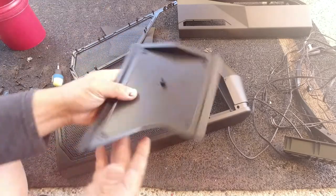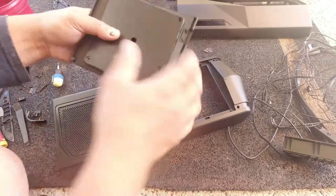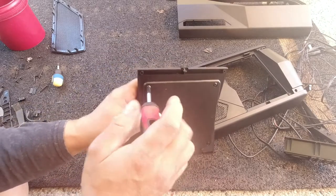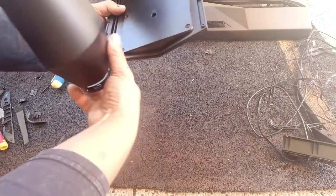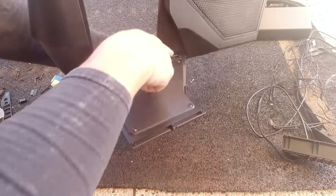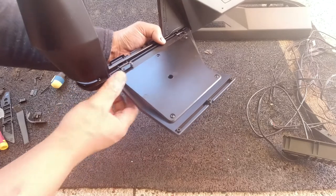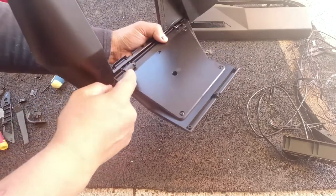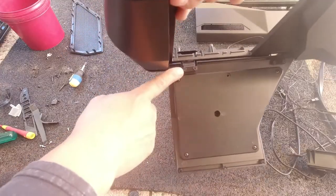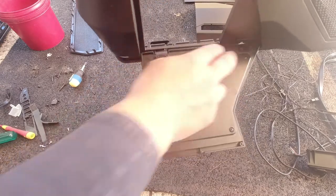This quickly goes over the top like so, and then we just simply put our screws back in. In order to get the hinges back on, you just line it up — it will sit in because you have a part of the hinge that sits inside it. After that you just simply line this up and it will sit right in, then line up your hinge and screw it in. There you go — that's our hinges back in. You put the hinge over the top and put the two screws in, same for the other side.